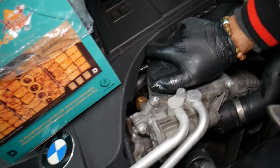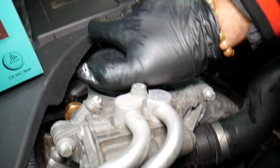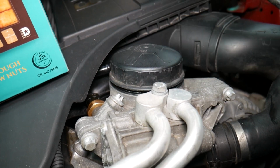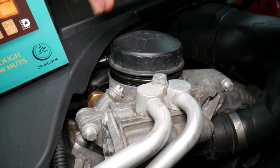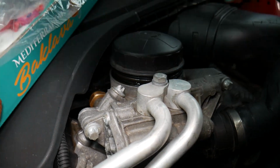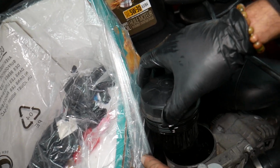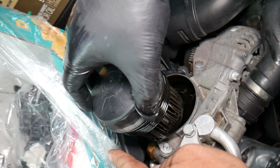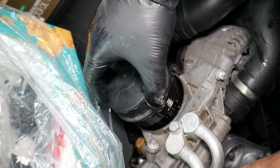Okay, that's what we're doing now. We have a seal there that's preventing us from getting it loose, but make sure you change all the seals on the oil filter housing too. We'll talk about that. When you remove that filter, more oil will drain in the oil pan and it will go in the bucket. So that way. Okay, lift it up, watch all that oil now. That's draining in the oil pan. So we're going to let it sit, it's going to slowly absorb it, okay?